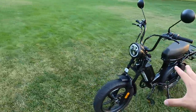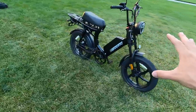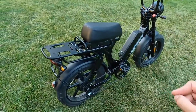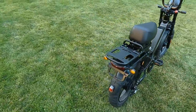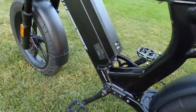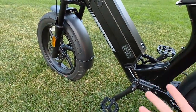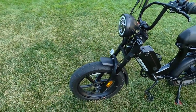The price is $2,899 for the Hyper model; the regular Scorpion comes in at $2,199 — a little less powerful with a 750-watt motor versus the 1,000-watt nominal Bafang custom-design motor here. The regular Scorpion also has a smaller battery: here we've got a big 52V 19.2Ah pack versus the regular Scorpion's 52V 13Ah. So significantly more capacity here, plus you get goodies like mirrors and turn signals.